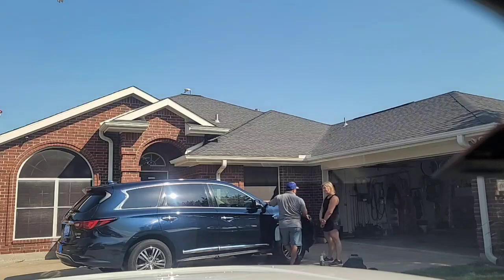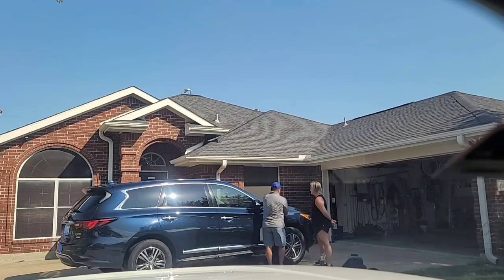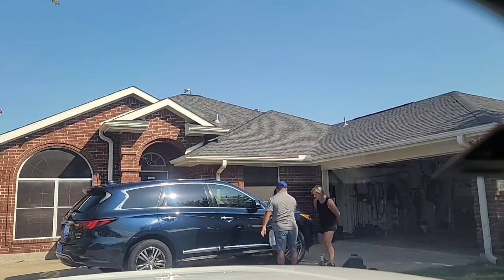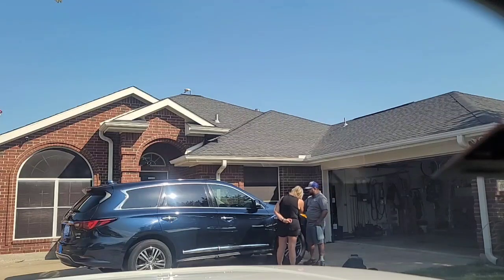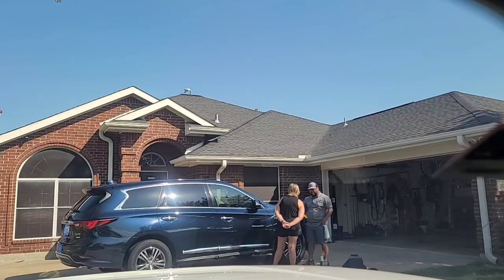Pretty much there are three options that you can choose from. Whatever you choose, it's really up to you — I'm not here to sell you anything, just kind of show you what I'm able to do to the paint. So this is pretty much how it looked before, which has the scratches, the water spotting, and all of that. This is what we call a one-step paint correction — usually I remove about 60 percent of the defects in the paint. This one will run you about $650. You can see, if you get on this side so the sun can hit it, you have a better visual. I would be happy with that. Within this one-step there are still some light water spots you will see, and you'll still be able to see a lot of these scratches.